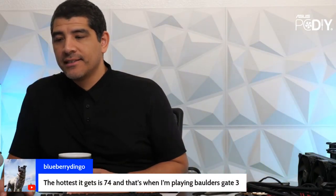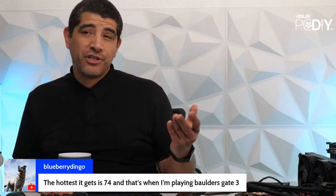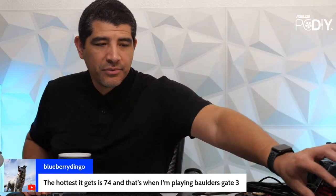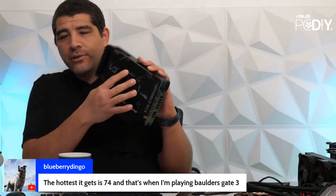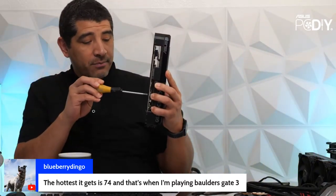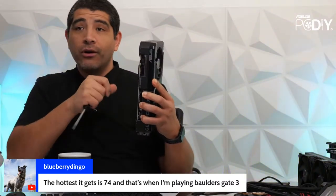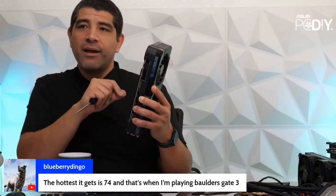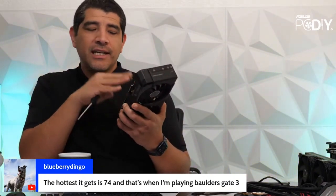Blueberry goes, the hottest it gets is 74 degrees, and that's when I'm playing Baldur's Gate 3. I would say you're fine. Again, that's an older GPU too, so you might also want to double check. In some situations over time, just through a little bit of vibration, you can sometimes have some of these screws become a little bit loose. So sometimes you might want to take a screwdriver and tighten up and just make sure those screws are entirely torqued in there. You don't want to over torque it because you don't want to crack or damage anything, but just make sure some of the tension hasn't decompressed, because if you're not getting good contact, that could be a factor.